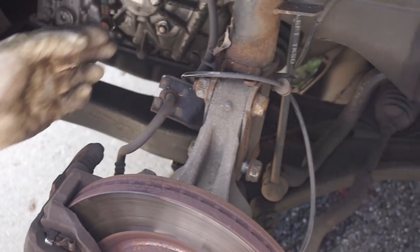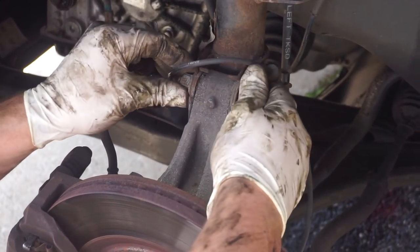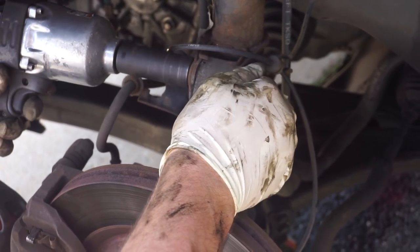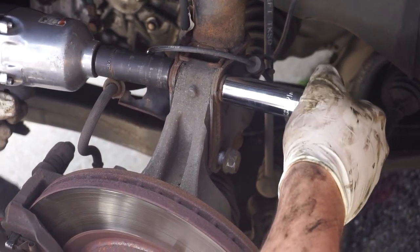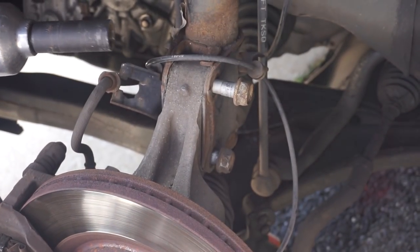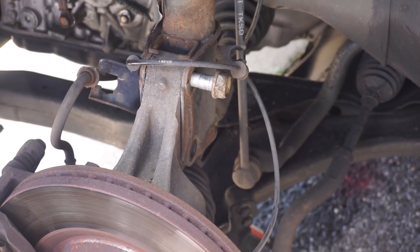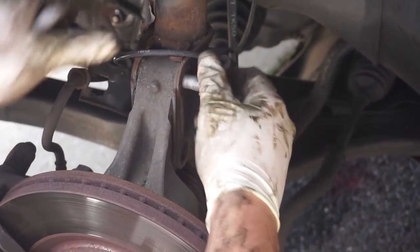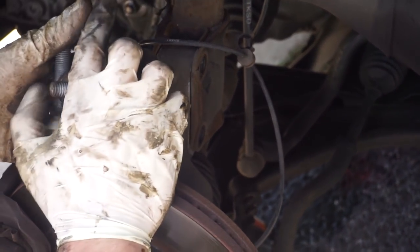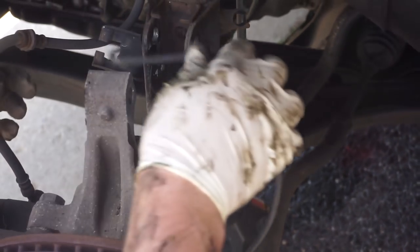Put it in a safe place so you don't lose it, then remove your brake hose from the clip. Finish undoing this and do the same for the lower. Don't lose your nuts and your bolts. Give it a little wiggle and very slowly lower it down, because you may need to grab a bungee cord to support these. Luckily we have enough space so we don't have to.